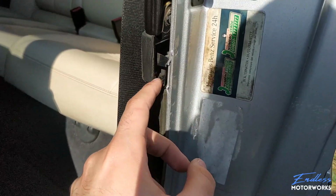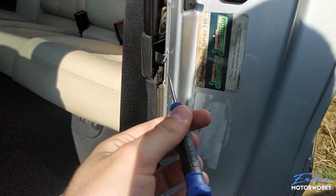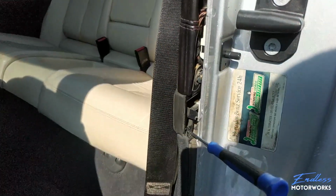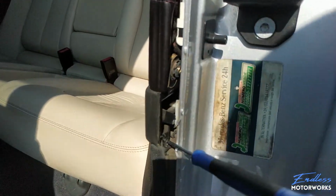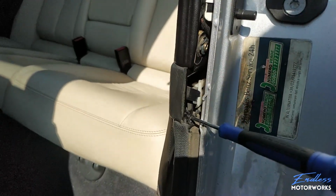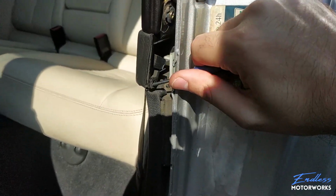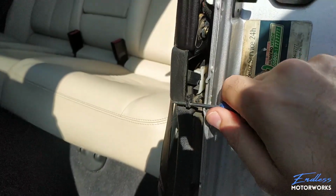this little prong. So what you need to do here is take a little screwdriver and jam it right here. So this is an actuator, a manual actuator that will release the hooks holding the panel to the bottom side. As you can see, actually here already, that's the first hook, and there are multiple of these hooks going all the way back. So when you take this out, it doesn't go all the way out, but it just needs to come a little bit out. It will in essence release all of the hooks from inside.